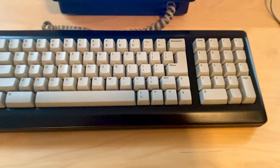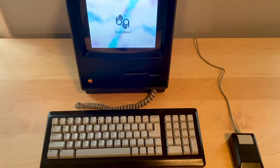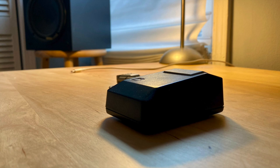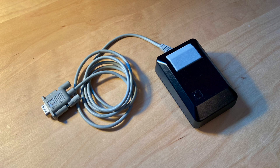In sourcing the keyboard and mouse for this project, it was crucial that we find the platinum color models of the devices, as the platinum gray would look better with the contrast on the black. The platinum model keyboard and mice, however, were from later in the Mac Plus's production run. Most of the M100 model mice that came with the Mac 128K through the Pluses in the United States did not have capacitors. However, this later platinum model colored mouse was a Mitsumi Japanese model that was produced in Japan. And the Japanese platinum M100 mice contained capacitors.